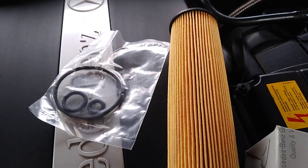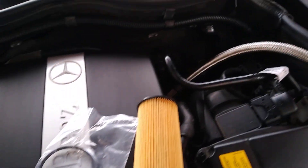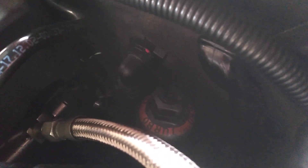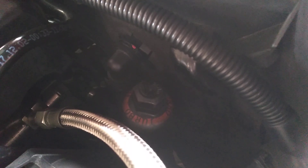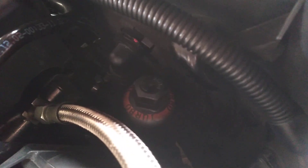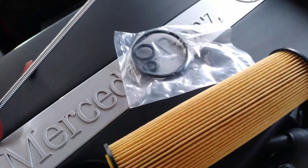When I change my oil I lift the cap off first before anything else. You can take the oil filter out without draining the engine oil - quite a handy thing to know. It's down the back here; you can see the red writing around the outside ring. Get your socket onto there - you'll need a universal joint to come at a bit of an angle due to the cowling - and turn it anti-clockwise. Be careful, it's plastic. Lift it out carefully with a rag underneath in case it drips, then stick the filter in your recycling system and fit your new parts. Always fit new O-rings.